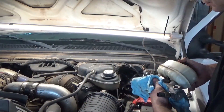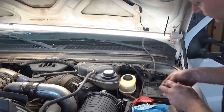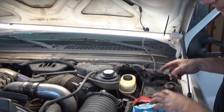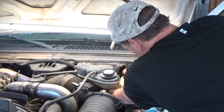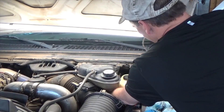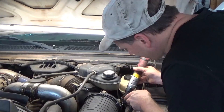There doesn't seem to be very much spring pressure on this clip — I'll just swap that with a regular hose clamp. This is one of those things — if you feel the need to replace it, it's probably a good time to. This is going to slide into where that shaft is; it should pretty much center itself. I'll move the lines out of the way for now, install the nut on this side, then make sure we put the bracket in and slide it back on the shaft, then install the retaining nut.